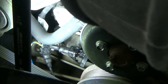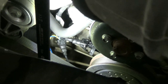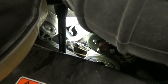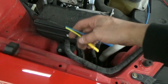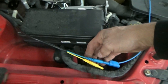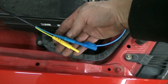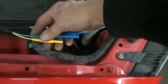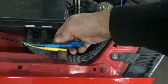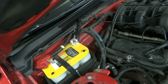On this vehicle, I'm hooked into the crankshaft sensor using the TA012 adapter that Pico makes. So you can just unplug the sensor — this is a jumper harness and it's going to give us two banana jacks. I've got those leads right up here. You've got to be mindful of the belt; you definitely don't want to get your wires tangled up in the belt. I've just gone ahead and probed one side of that crank signal — they're going to make a mirror image of each other, so it's not 100% necessary which one you grab unless you're comparing it to a known good. A lot of people like to use the main signal as opposed to the sub-signal. And then I've got both of our grounds hooked to the battery negative.